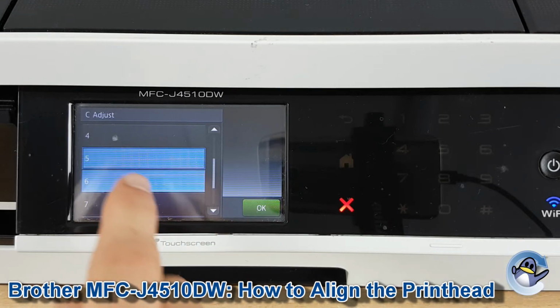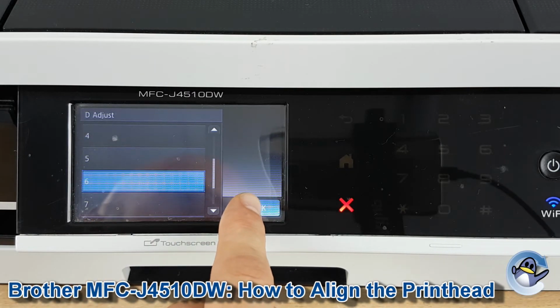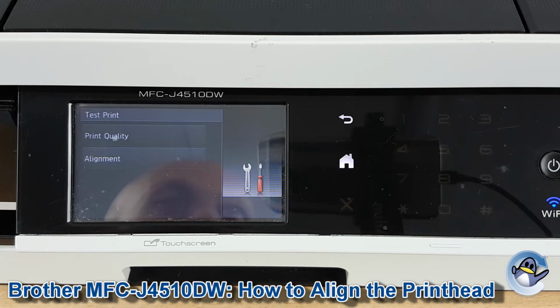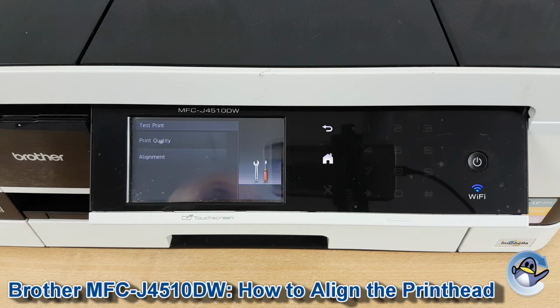And what we're basically doing is fine-tuning the alignment of the printhead, improving that print quality, and hopefully removing any kind of small, hard to identify issues your printer's having. As I say, traditional cleaning cycles and test prints are probably the best thing to do first, so if you haven't done those already, now's a real good time to go to print quality and run through those. If you wanted to check them out, we have separate videos on both cleaning and print quality test pages on our channel.